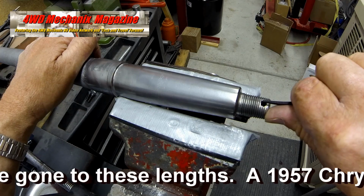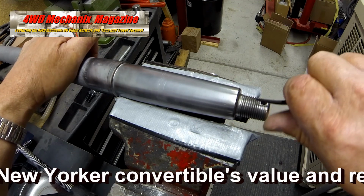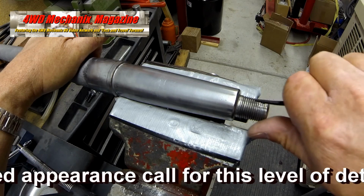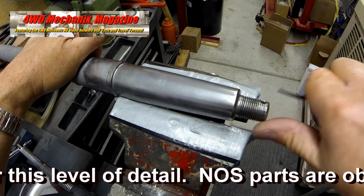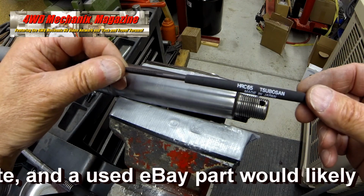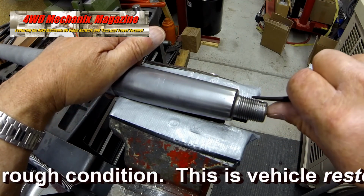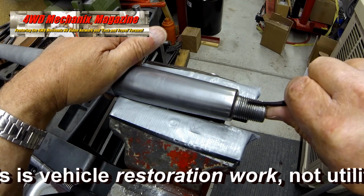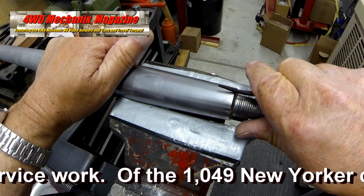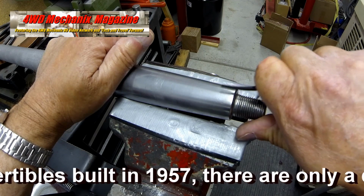The shaft thread material is harder than HRC 60. The 60 HRC file does not remove metal from the threads, either in the original thread section or the repaired section. This indicates that the material is harder than 60. HRC 65 is now tried and does remove material slightly. A guess would be that this material is 61 or 62 HRC. It is distinctly over 60 HRC and consistent with the OEM hardened surface.